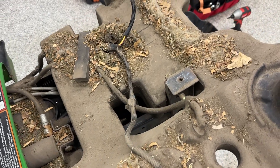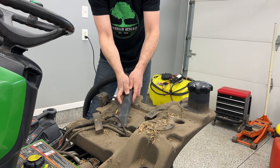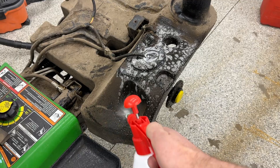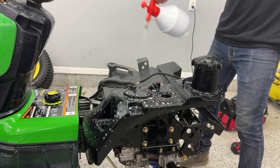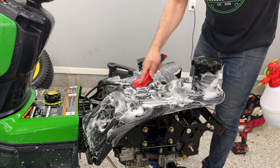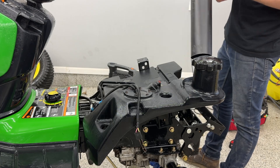I had a lot of leaves, dirt, and debris under that bodywork resting right in the area where I needed to work. My obsessiveness with cleaning and my desire for not getting dirt and debris into the open fuel system meant I just had to clean it up before moving forward. I started by vacuuming the big stuff, then I degreased the area and let it soak. I rinsed it off, degreased again, let that sit, scrubbed with a brush, rinsed freely, and then dried it with a leaf blower.